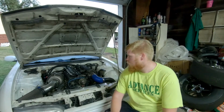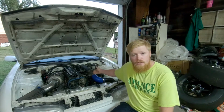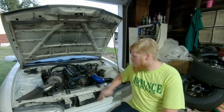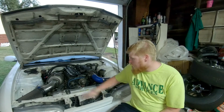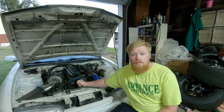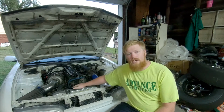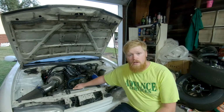For an ECU, of course, I'm going to recommend ECU Master. That's what I've been running on this car for the last 2 years. That's what I started running on my RB26 car. It's been fantastic. It supports like everything. I've got AEM smart coils, it supports them. I've got FIC 2150s, it supports them. I've actually just turned it up. I'm on 35 pounds of boost right now. I've got to get back on the dyno, but it's supporting everything and it's having no problems whatsoever. It's very capable, and I 100% recommend it.